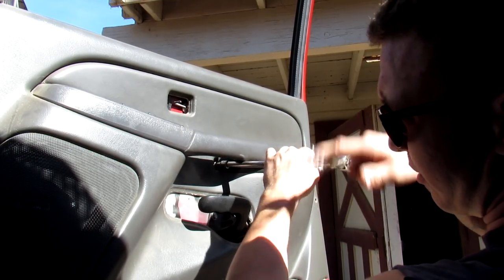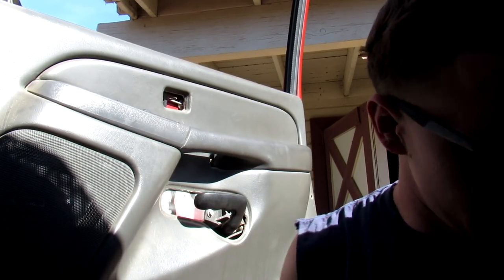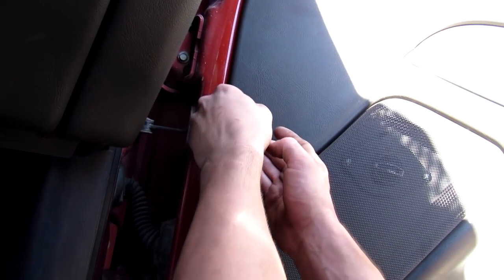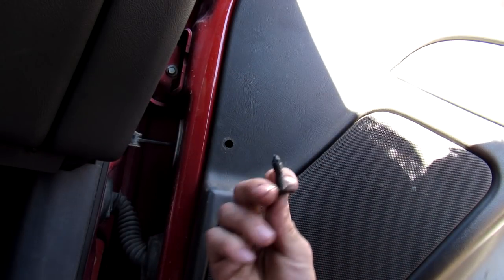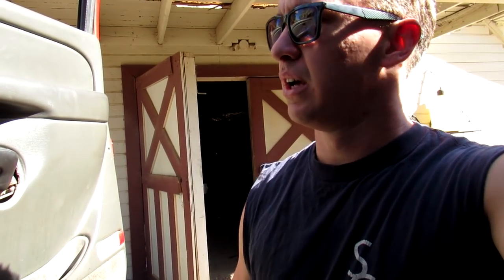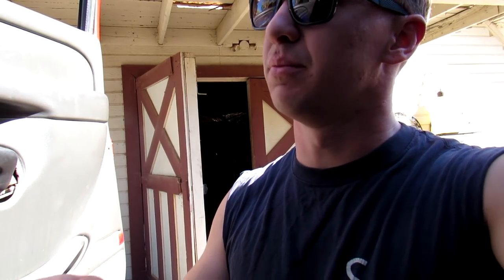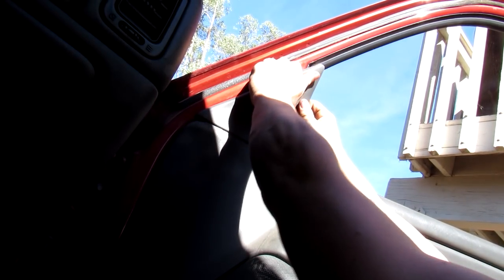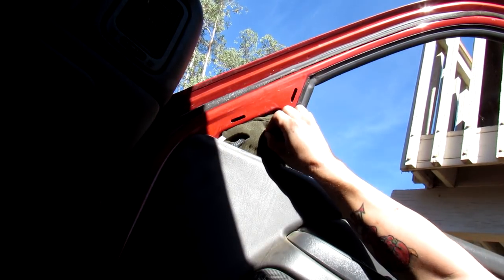I couldn't find my small ratchet — I'd rather be doing this with a small ratchet, it's easier to get the small 7mm in there, but this will do the trick. The last thing is there's a little pop rivet right here, just a plastic body clip that comes out. Now I will say, because we have tweeters wired into my doors, I can't just unplug them and take them off as easy, so I kind of have to hold it. Right up here this just pops out — take this off, just two or three little body clips — then you can take this foam right out of there.